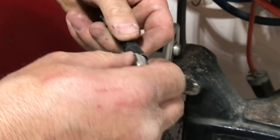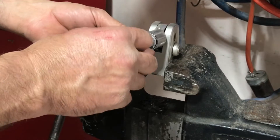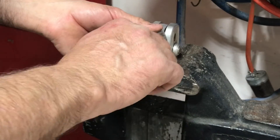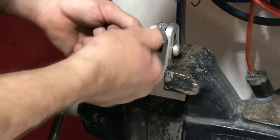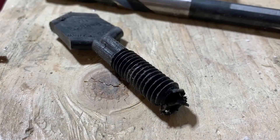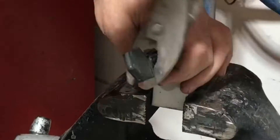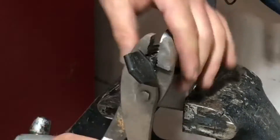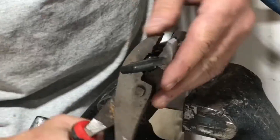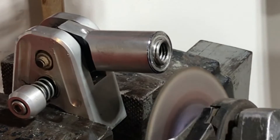Make sure you clean all the debris out of the hole before putting the new insert in. The helicoil kit includes a tool that you thread the insert onto, and then you thread that insert into the hole just like you would a bolt. When buying a helicoil kit, try to make sure the installation tool is made of metal and not plastic like the one I'm using — the plastic ones, especially with bigger sizes, have a tendency to break during installation. Because I wasn't able to drill as deep as I'd have liked, it got tough at the end and I had to use pliers to help turn the insert into the bracket. You'll also notice a little bit of thread sticking out above the bracket for that same reason.